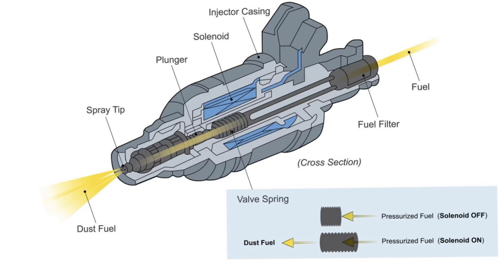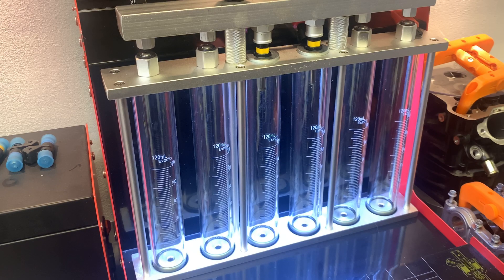You need to understand: this test stand works by adjusting the number of impulses rather than modulating pressure. This particular injector is not reacting at idle speed and not even at medium speed. So on the bike, we would see it run on idle on one cylinder, then start to pick up somewhere in the middle or upper RPM range, and under full throttle it might run fine — while throwing lambda errors and other fault codes.